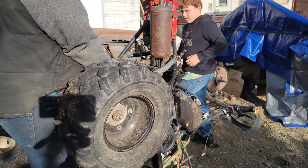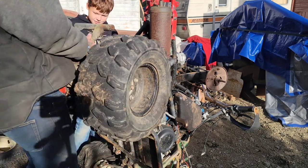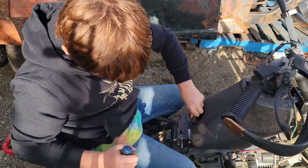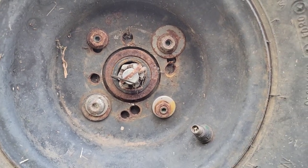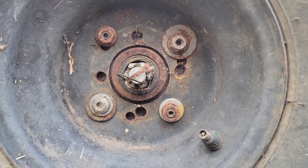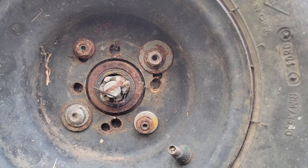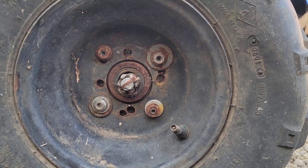Go to the other side and pull it out. It's always gonna get worse before it gets better. Now I've definitely seen some things, but this is new. Not sure what bolt pattern it's supposed to be — there should be four nuts and not three nuts and an allen head bolt. It looks centered, but I'm definitely gonna have to investigate when we take this off. We're probably going to end up doing a 'how to rebuild your hub' portion of a video soon.